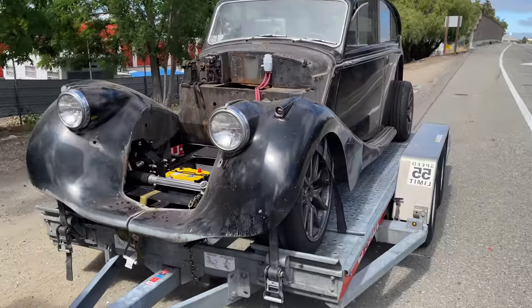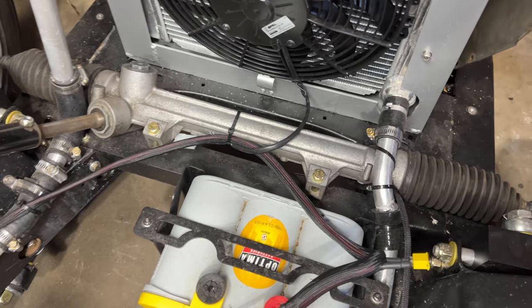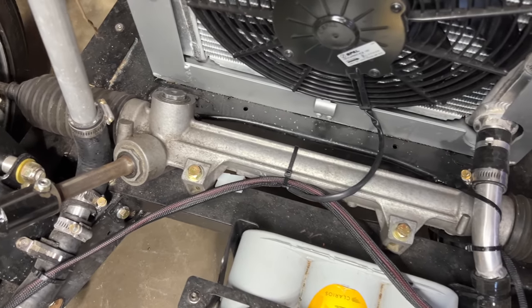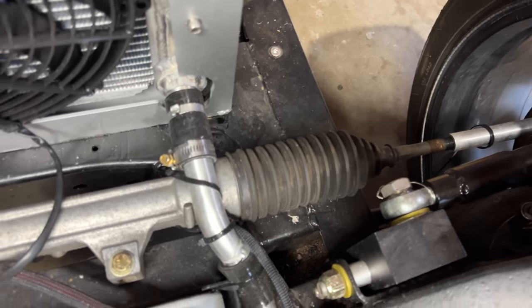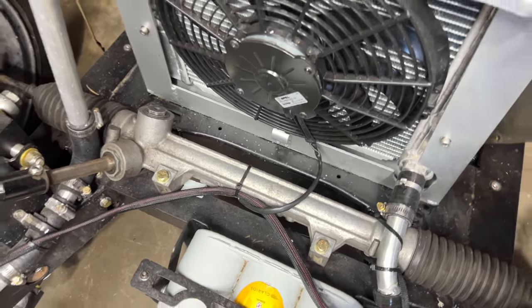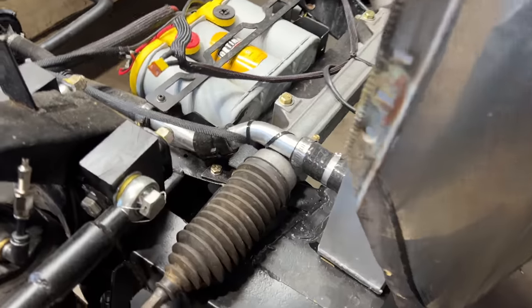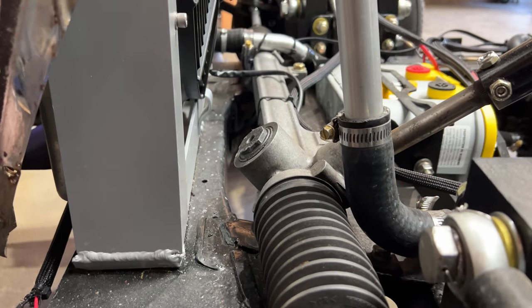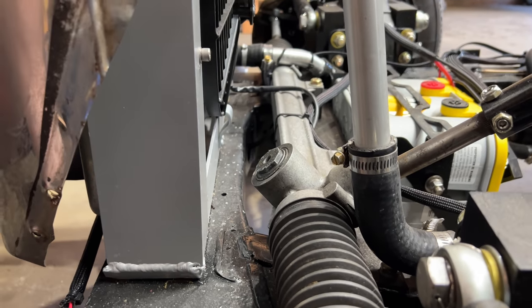I don't remember if I talked about this rack or not. I got it from eBay for pretty cheap, mostly because I needed some steering to happen when I moved. It's from a BMW Z3 — maybe Z4, I don't know. I just looked at cheap racks until I found one that had the right ratio, the right length, and had mounting holes in a location that I could use. This one worked out well. I have a power system, so I want a quicker ratio than you normally find on non-powered racks. There are expensive solutions out there, but the junkyard BMW will be excellent for this application.